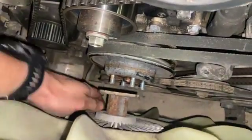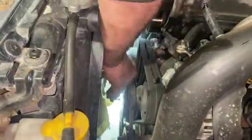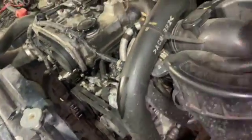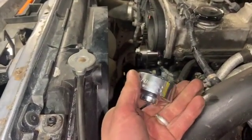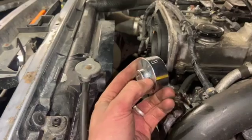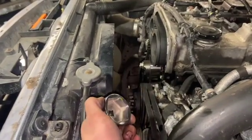With the fan loose, I'm going to tuck it to the front — it allows a lot more room since it's really tight to get in on that bottom pulley. Use a flat screwdriver to flick that little rubber cap out of the center of the bottom pulley. It's a 38mm socket — I'll put a link in the description to these shallow ones. They're quite handy; we use them for oil filter caps as well. We'll put a long-reach ratchet on that and that'll allow us to turn the engine over.